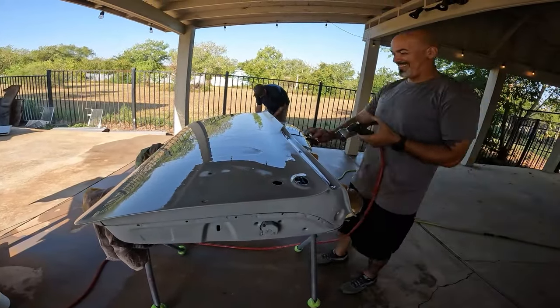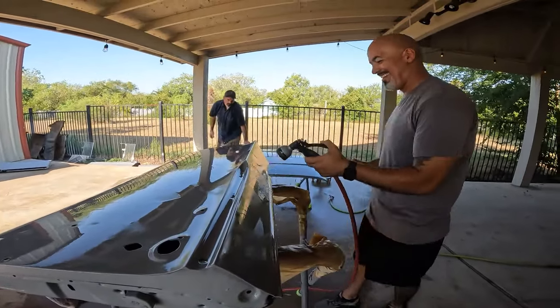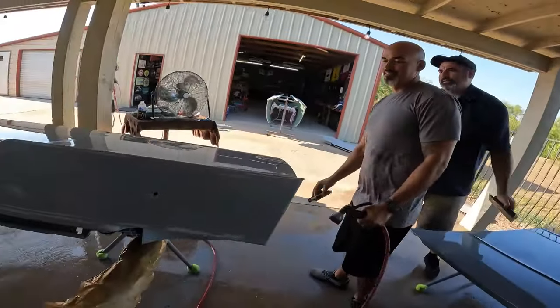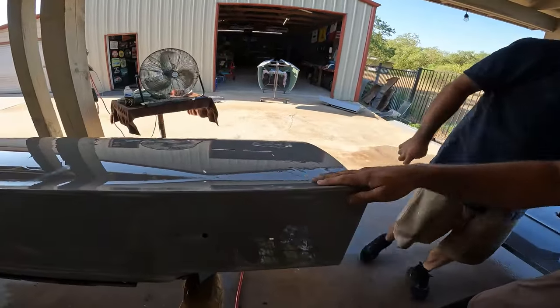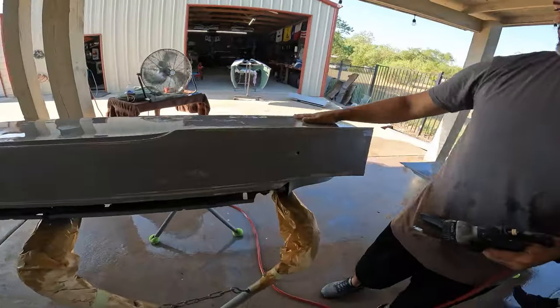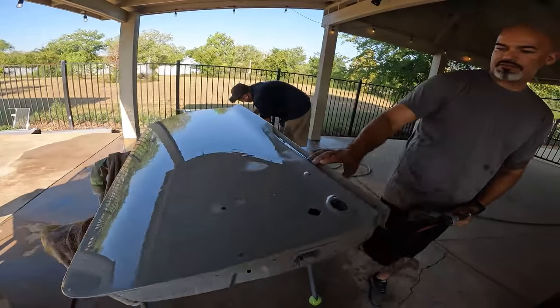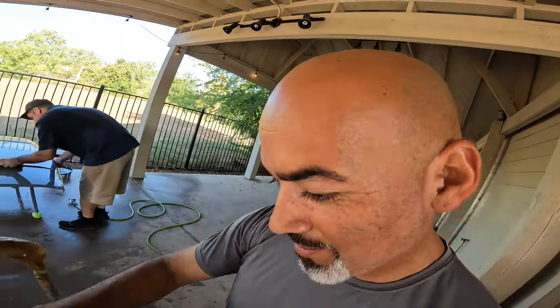You are taking off the finer scratches. Right here. So we did guide coat 400 and now we're in 600. So we're about finished. That sucker's smooth. Gotta dry it off real good. And smooth like your head? Yes. That's 1000 grit, 1500, and then the buffer.